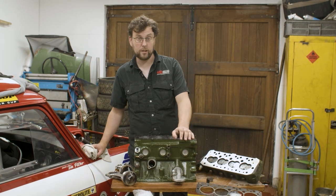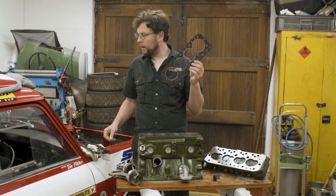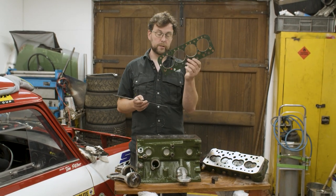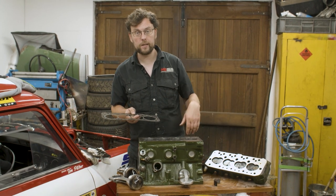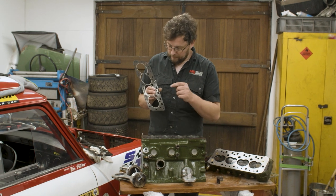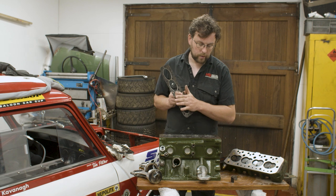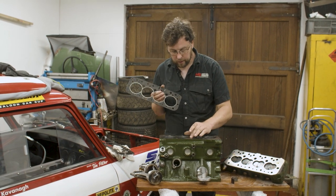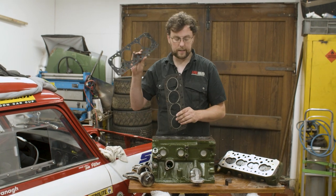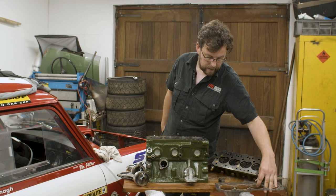If this was the first time I was building this engine and wasn't sure of the specification, I would much prefer and recommend the BK450. You might wonder why I didn't use the BK450 — well, there was a shortage of BK450s a while ago and this AF470 was the only one I had in stock. We were at the racetrack in a pinch, said we'd stick it on and it might get the race out of it — unfortunately it didn't. BK450s are a very good gasket: if you have your clearances right and good surface finishes they work really well and are much more forgiving. If you're not 100% sure about your surface finish, the BK450 will more than likely seal, whereas with a Cometic-style MLS gasket, if your surface finishes aren't right it more than likely isn't going to seal.